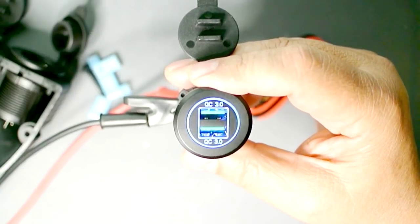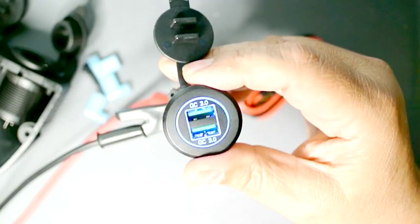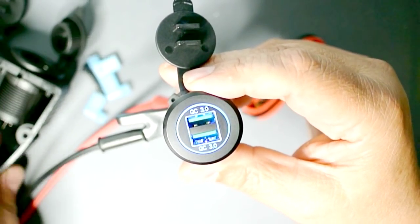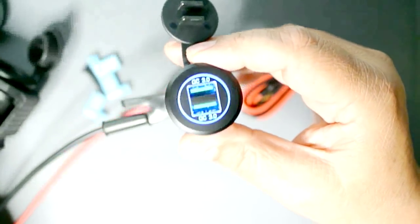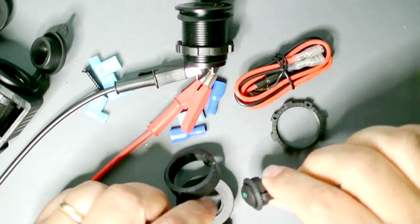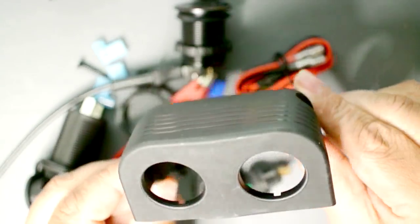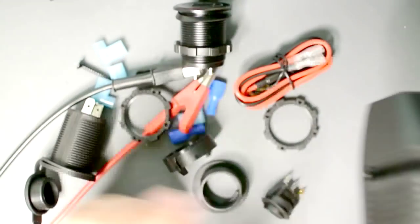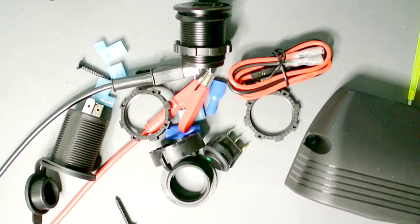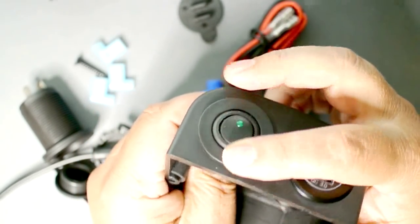The Quick Charge 3 outlet has a little blue backlight and the same 0.1 milliampere discharge, so I'm going to put a switch on the other side. I'll be installing this switch that comes in its own little bezel. It's a shame you can't just buy this without everything else, but we'll have a switched USB output.